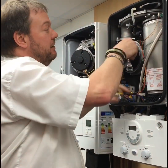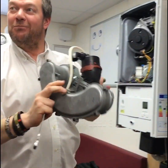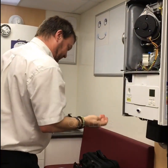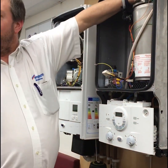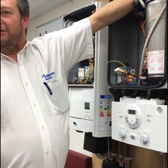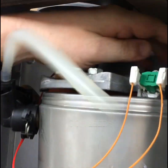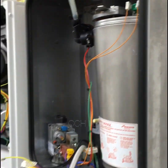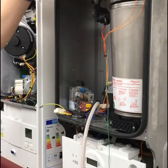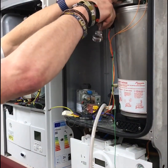Now you can disconnect your fan — the fan swings out and out it comes. While you've still got that in place, disconnect your electrodes, because if you take that nut off, the plate starts moving about when you're pulling on the electrodes and they'll start moving and turning around. So that's the way to do it — disconnect the rest of your wiring while you've got your fan out.